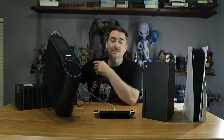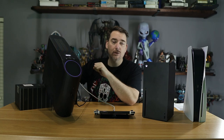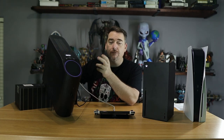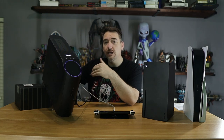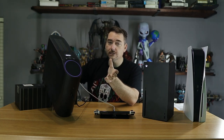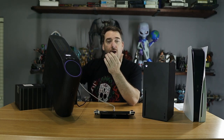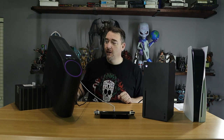It's not much. You've also got things to think about like a TV — a 4K television is going to cost you far less power than you might expect, about 80 watts. Your receiver for a single channel is about 170 watts for something like a Denon. Every channel you add — say a 5.1 surround sound system — is another 70 watts per channel after that. Add a powered subwoofer and you can see how this starts to add up. Most battery backups I've seen are 1000 watts or less. Think about the devices you've plugged in and how fast that adds up. You don't want to run these things at max power, so having a little bit of headroom is important.